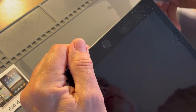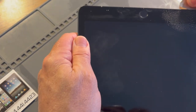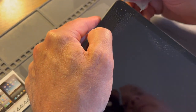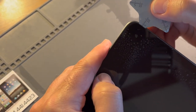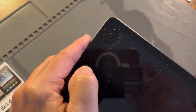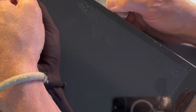This particular iPad is having just fragmented mainly at the top. This is usually not this easy — your iPads are going to be much more frustrating typically because the way they break is usually over the entire surface. I have these little marks on here so I can see my depth — I'm going five millimeters. That keeps me from going too deep. It's deep enough to cut the adhesive, but it's not going to let my tool hit on the actual LCD screen underneath. So it's very important we don't damage the LCD.